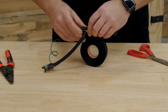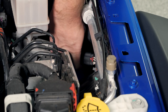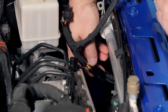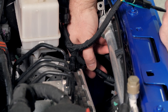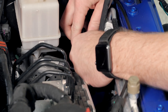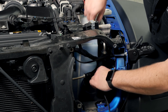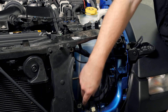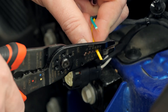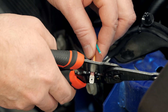This connector is going to plug in place on the driver side and passenger side at the connection to the fender flare. You can access this connector by reaching down just in front of the brake booster, unplugging the red locking tab and pulling the connector apart. Install the T-connector in between the two factory connectors, then fish the wiring harness towards the front following the factory wiring, pulling it out of the headlight bucket at the front of the grille. At this point, cut the wiring to length and crimp two male spade connectors in place that will plug into the harness on the back of the Tactic headlight.